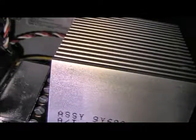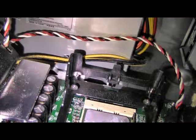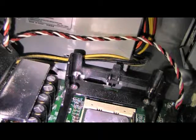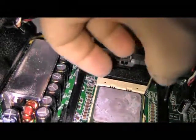Two retention clamps are out, and this old boy here has a couple of clips keeping it in place. That was almost where I started crying - about two full minutes have passed at least, it seems that way. The back of this thing has ages worth of thermal grease on it. I'm going to put a little more on - I ain't going to clean that up. There's the CPU - let's pop this baby up, lifting the little lever on the side.